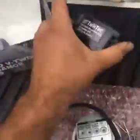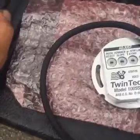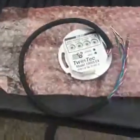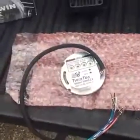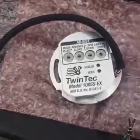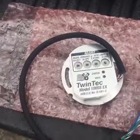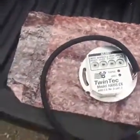And then this is the single fire coil. So you got the mode select, single fire, dual fire, multi-fire. Now advanced slope, what that does is allows you to adjust. I don't know how to put it. If you've seen a dyno before, it goes up in a slope just like that. What that allows you to do is, at certain RPMs, more power. You can do more advanced slopes. Obviously, it's at a 0 right now. If you got a stock engine, you'll probably run 3, 4. I'll probably be running 7. I don't know. I'm going to take it to the dyno after I get it put together and running. Like I said, that allows you to enhance performance, more advanced curves.